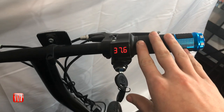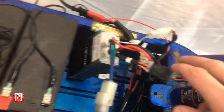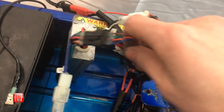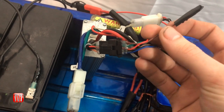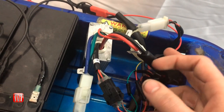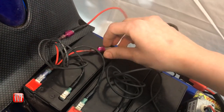If you buy one of these replacement throttle handles, here's how to wire it. Keep the connector from the old throttle handle and splice the wires together. Note that the brown wire didn't work with this throttle handle — it uses a yellow wire instead, which I wired directly to the main power going to the battery.